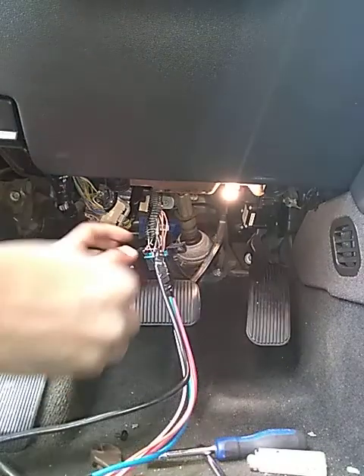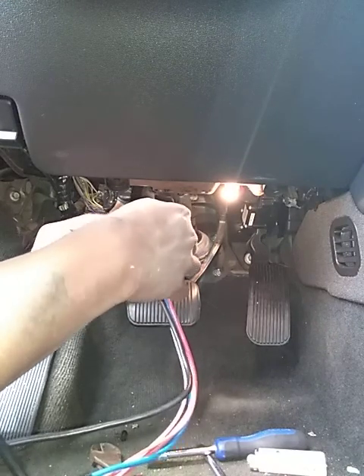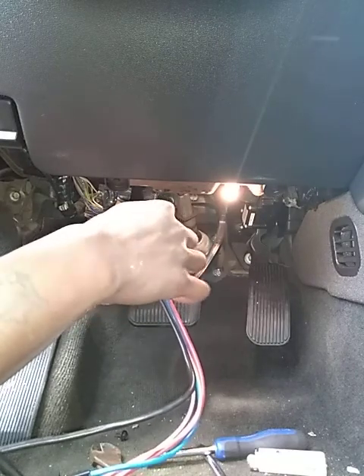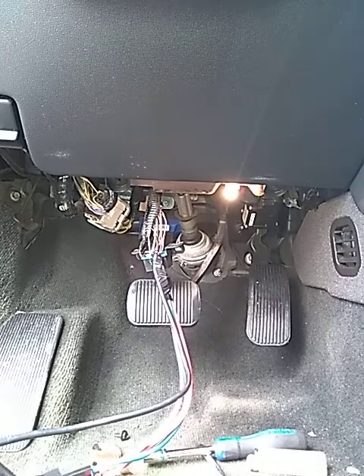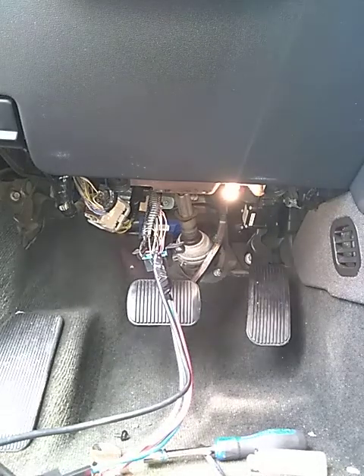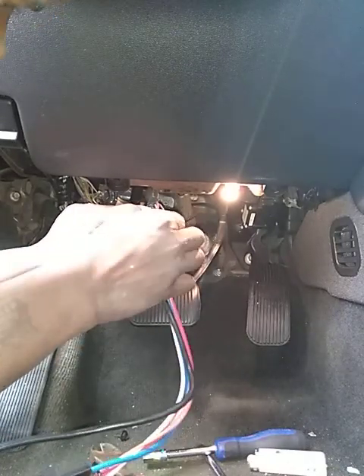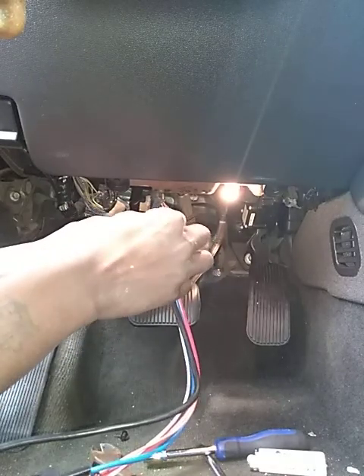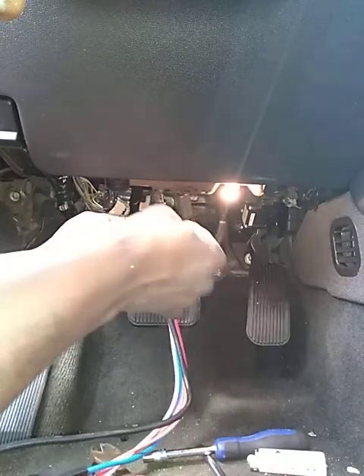You want to take and tape it. First you want to tape up your hot wire. What I do is just put a little pinch of tape on there just so they don't connect — you don't want them to touch. You want to tighten up your ground wire that you put on there and put a little tape on there too, just so when you wrap it overall it doesn't touch.